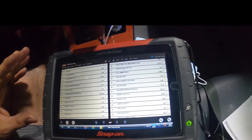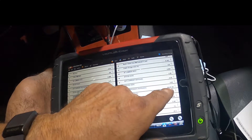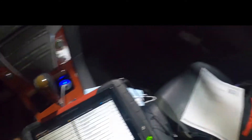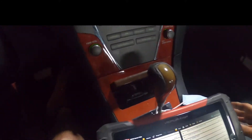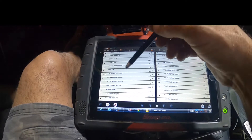When I rev the engine up and put it in a lean condition it kind of levels out a little bit, but then it's jumping again. So bank two sensor two is the one we're going to replace. There was also a misfire code, but looking at the misfire data right now there are no active misfires. I've seen in the past where a bad O2 sensor will cause a misfire and even cause the car not to shift correctly — O2 sensors play a big role in the operating system. So I'm going to replace the O2 sensor first, clear all the codes, take it for a long test drive and see what happens.